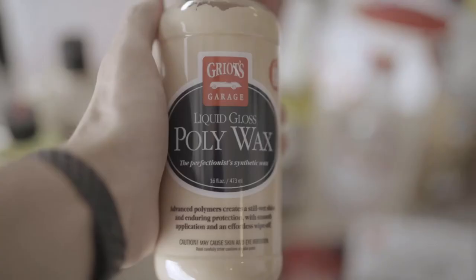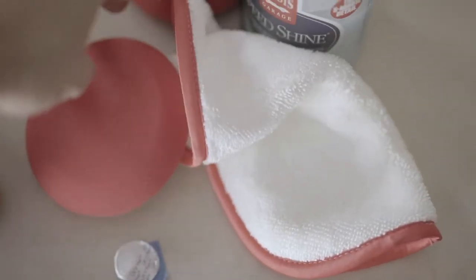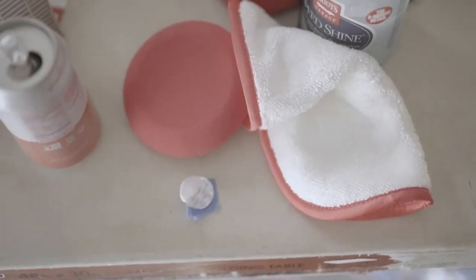Quick update: I polished all the parts of the car I could. Towards the end of the polishing phase the pad started over-saturating the paint — I'd go over it and it'd be completely wet and leave marks when wiped. I made the mistake of buying only one finishing pad and definitely should have bought two to swap halfway through. For an SUV I'd recommend three pads to be safe. We're moving on now — going to put the poly wax on. It came with a microfiber application pad and a microfiber cloth to wipe down when done.